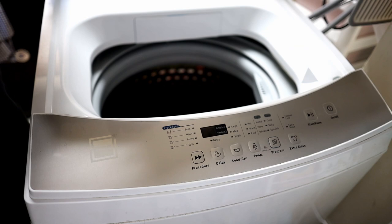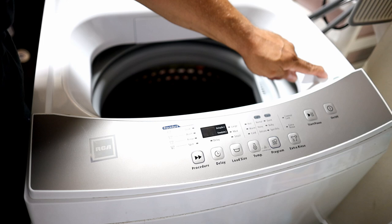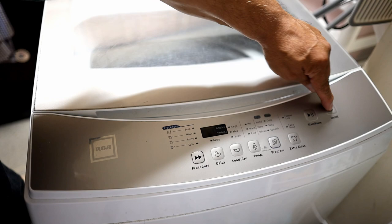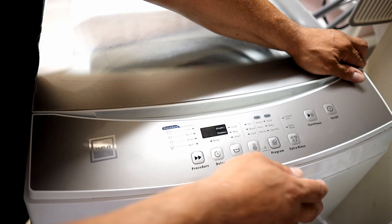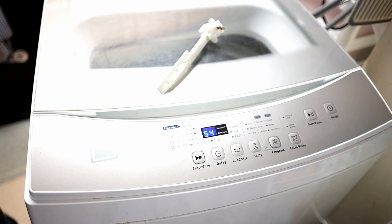Okay, we got that machine going. After we bypassed the lid switch, I think there's a second switch right here — looks like a rectangle, I think that's a magnetic switch, and I think there's a piece of magnet in here. We had the lid on but we didn't screw down this side. We screwed it down and everything seemed to line up. In the previous video I had to actually shift the door over a little bit for it to start — but if everything is lined up properly, this machine is very annoying. It should start and I should get no more E3 code. I got an E3 code again. Okay, turn it off — push the door ever so slightly. Tell me this is not annoying. There's the lid switch out of the unit, and you guys just saw me bypass it and it's running. But this door is way too finicky — I'm pretty sure that's a factory defect. I hope you guys don't have the same problem, but if you do, you know how to figure it out.